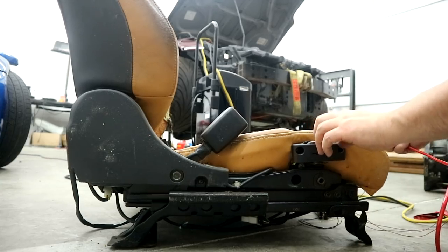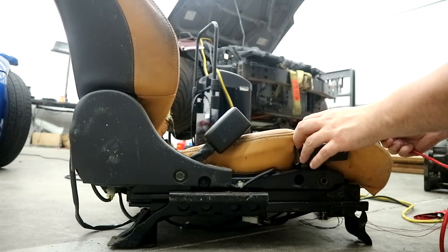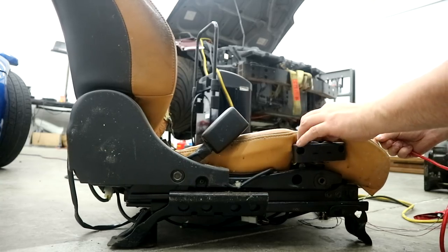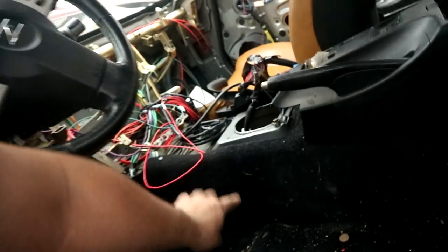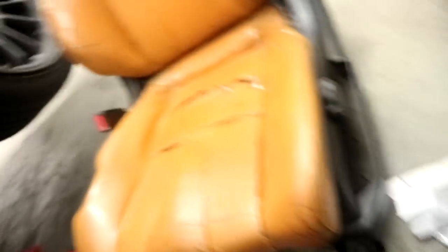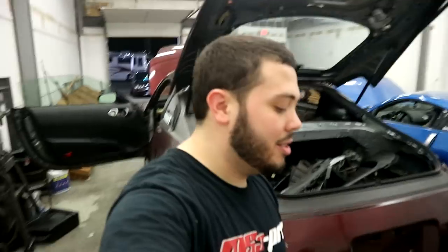Let's see if the motor works. Hey, that's it - the whole thing works! I don't even know what those other wires are, probably accessory, but dude that's mint. Now all I got to do is search for a switched 12 volt. I've found a switched 12 volt off of the ignition that goes to the fuse box, which is fused. It goes from there down into here, across, and right into the seat, tying into this white wire. Green is ground, guys - future me, remember green is the ground. I figured it out and that's all that matters.